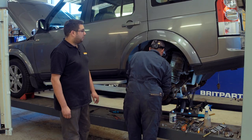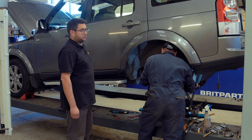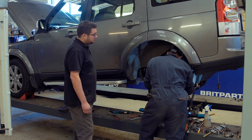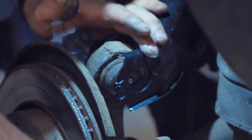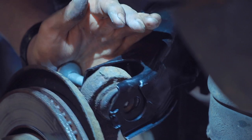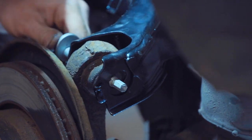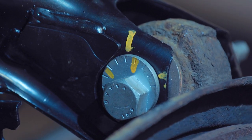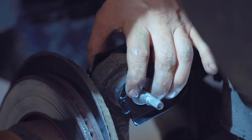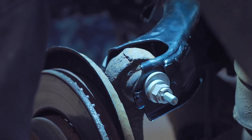It can take a little bit of wiggling — the arm will still move freely up and down, but getting the hub ball joint lined up in the socket in the arm can be a bit tricky. There's quite a lot of weight on the hub from the brake assembly so getting that bolt started can be a little time consuming. We've also transferred the paint marks from the old arm and old bolt onto the new items so that when we tighten everything up we can be as close as possible with the wheel alignment. As we say, whenever you've replaced suspension arms you need to get the four-wheel alignment done anyway, otherwise the tyres could wear unevenly.